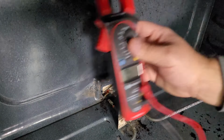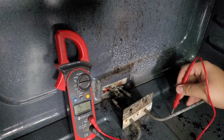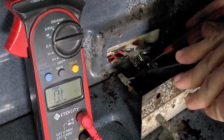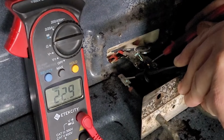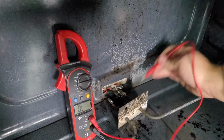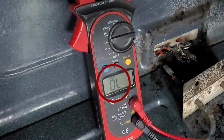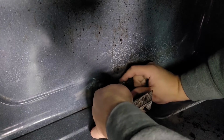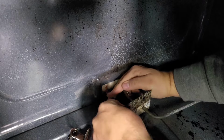Switch the multimeter to ohms resistance, then you will place the leads on the bake element, the one disconnected spade and the one plugged in still. Keep the leads on the element for a few seconds until it stays steady on a reading. A typical stove element will be between 20 and 40 ohms resistance if it's good. If you keep getting an open line or OL signal, then there's a break somewhere in the element, and that is definitely what is bad on your stove. Once the element has been tested, reinstall the element and secure it with two screws.